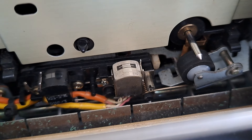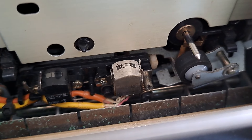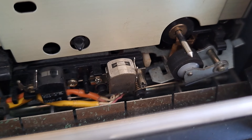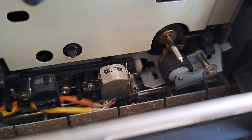You can see on the top track of the head there's some scoring. I'm pretty sure that's all the way through to whatever's in the middle of the head or the pickup. There's a severe gouge where the tape's been running. Someone's used this deck quite a lot — it's had a lot of good years out of it, I think. But yes, it is going to need that.